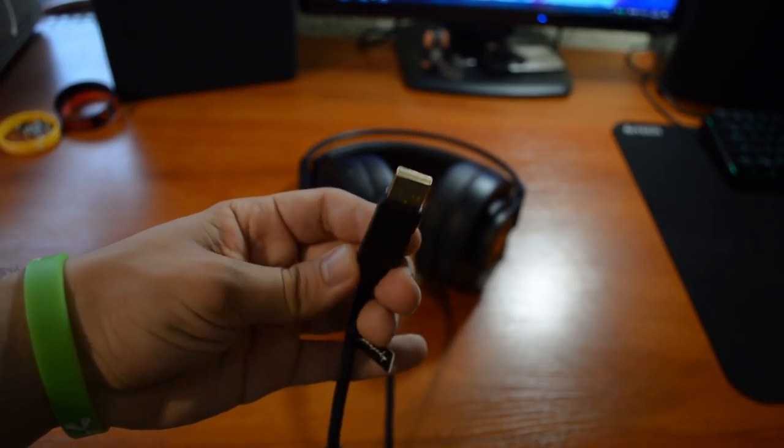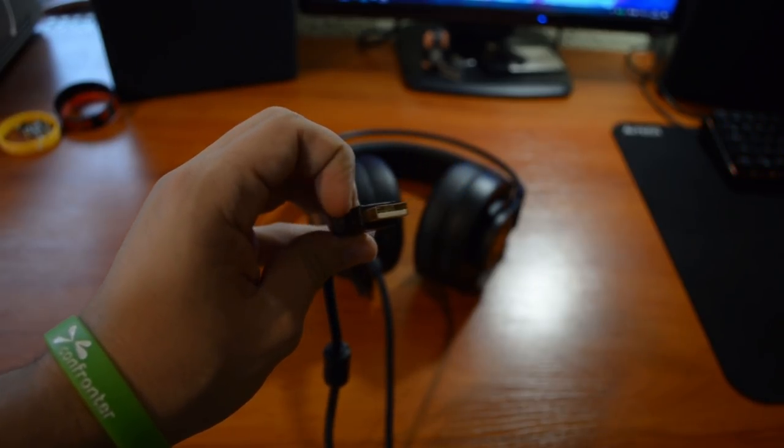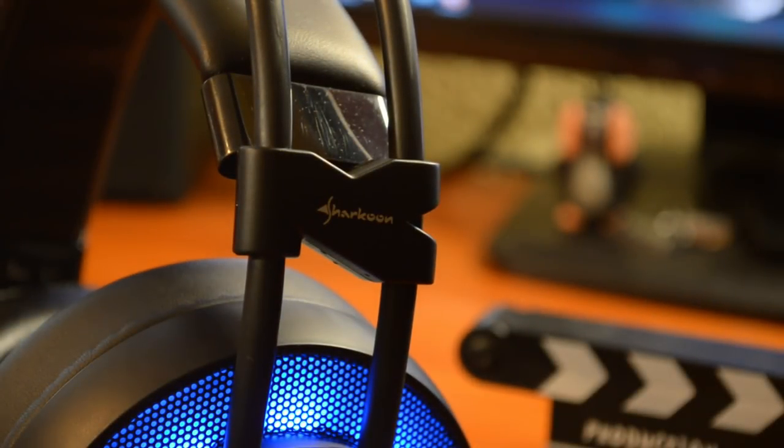On the topic of the cable, it is worth noting that these headphones use USB. And personally, I think that if you are buying headphones dedicated to a computer and dedicated to gaming, it is very good that they are USB. Because it is not uncommon for the onboard sound cards built into our motherboards — or sometimes even the front panel cables of our cases — to be of really poor quality, which affects how the equipment sounds. An additional benefit is that when headphones are connected via USB, they identify as a separate sound card with a microphone. For example, my onboard sound card has very poor Linux support, and when I had my regular microphone connected and spoke on Discord on Linux, you could constantly hear noise. After plugging in these Sharkoons, they identified as a different, well-supported sound card and the problem was solved.